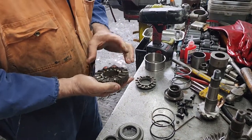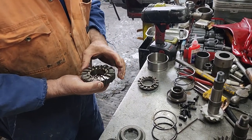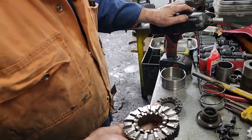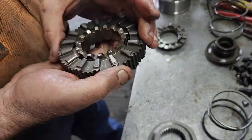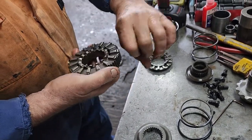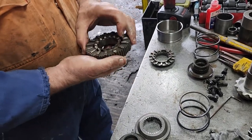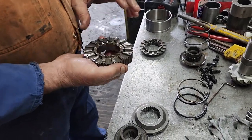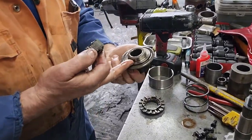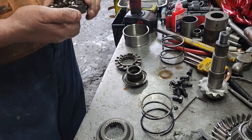This is a nine-inch Ford Detroit Locker — same thing used in an MG. Because it's an enclosed carrier and a nine-inch, there's either a spline around the outside or four trunnions like universals have. This is the exact same thing except the gears are 25-spline, which is what MGs have. Some race cars have this.